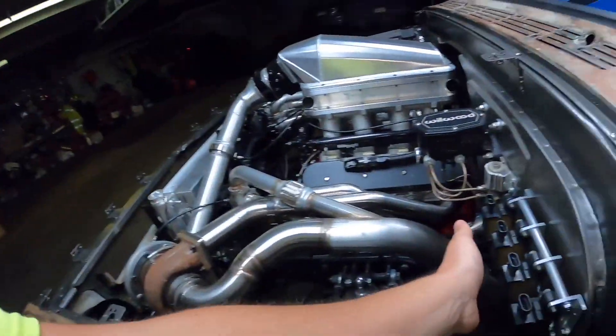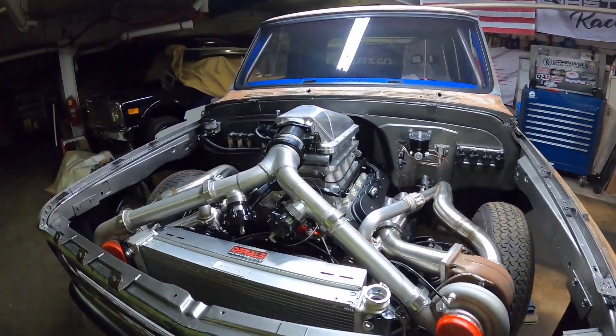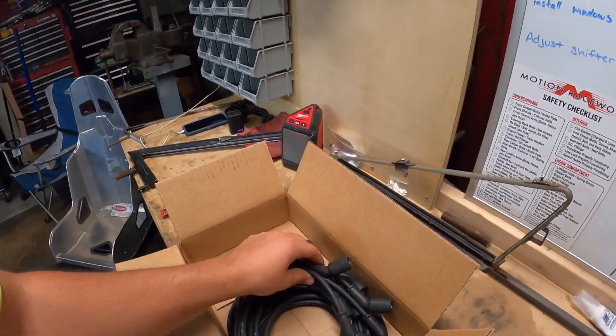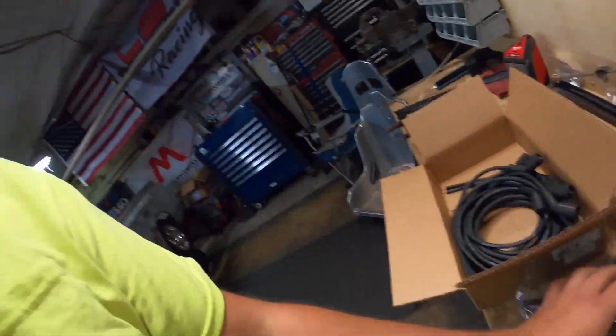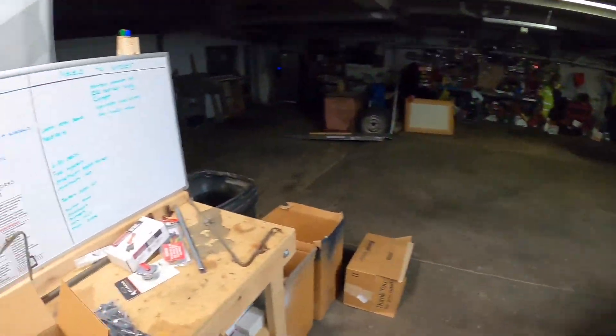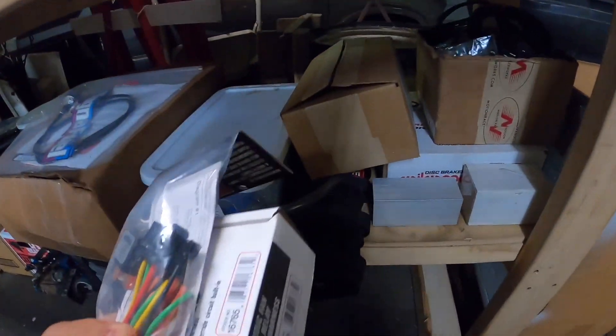I'll put a label on the end that goes on the actual coils on the firewall. That way if there's any issues — a cylinder not firing or going dead — you can look at it real quick and know which coil is for which cylinder. Actually Devin's harness might already have that labeled, I'm not sure. I'm going to look and see if I have the crimping tool, but I don't think I do, so I might make a phone call and see if a friend has one.